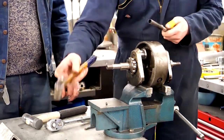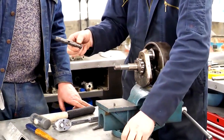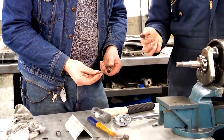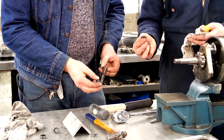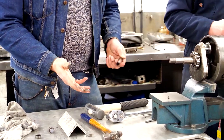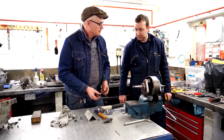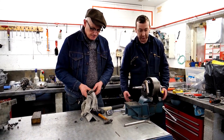It doesn't look too bad — it is dirty, but it's not completely packed. These can quite often be completely packed out with stuff. You can see it's a very black, gritty substance. That bears out what we said — it looks like somebody's done the big end shells on it, probably cleaned this out at the same time and hoped to get away with it. What they quite often don't realise they need to do is clean out the oil tank before they drain and refill, otherwise that dirty oil is still in the tank.